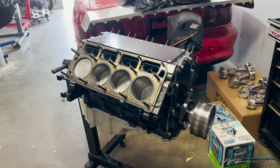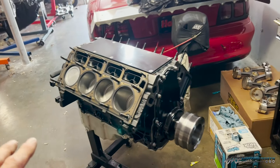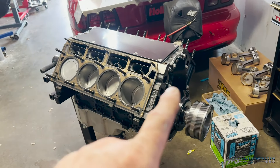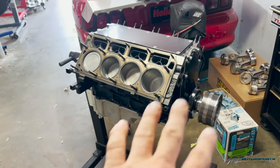I've been working on it for the last week or two. We got the short block all put together — gen three and a half is what everybody would call this. Third gen iron block, all the same length head bolt holes. It's got a Sloppy Stage 2 cam in it, all new lifters, lifter trays, new bearings, oil pump, timing set — everything is new.